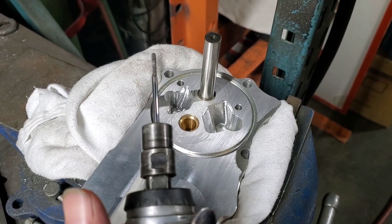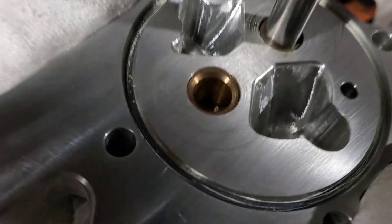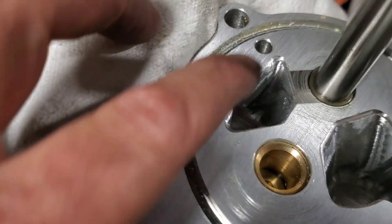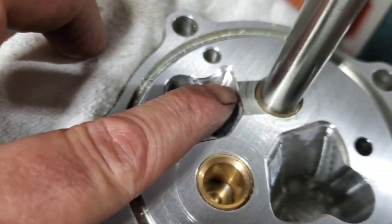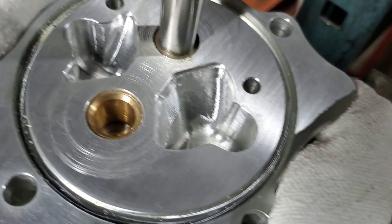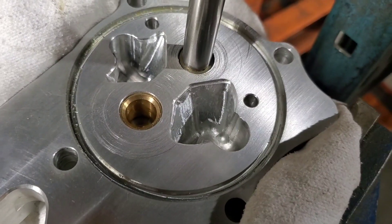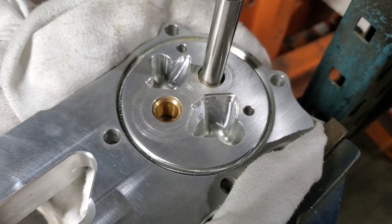Using this small bit and porting tool, we didn't get all crazy or anything — we just came in here and eliminated some of that excess material and sharp edges. That way we can maximize our flow, get the best fluid dynamics. Just some KMR tips.